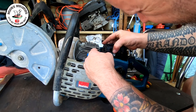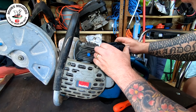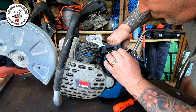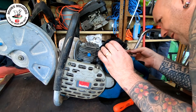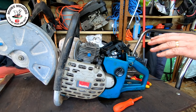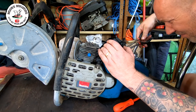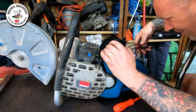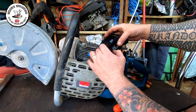It will start to slowly lift — you've got to have little fingers! So that now lifts up and then you'll have a fuel line on the back of this. That fuel line is one that's perished and that goes to a cylinder. With repair long nose snips you can get them behind — this is like the fuel line that goes underneath the carburetor. Gently remove that without doing too much damage. That's now removed — I should be putting a new fuel line on there.